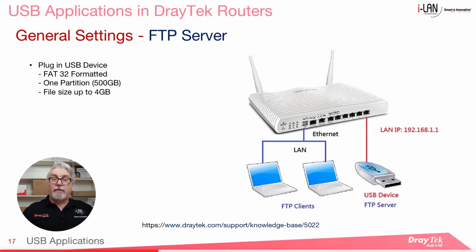For the FTP server, we just need to plug in a USB device that has been formatted to FAT32 into the router USB port, keeping in mind limitations with the FAT32 file system in that only one partition is supported with a maximum size of 500 gigabytes and the maximum file size is 4 gigabytes. Configuration details are covered in Knowledge Base Article 5022, which I'll link below, but I'll briefly go through the basics of how to set it up.